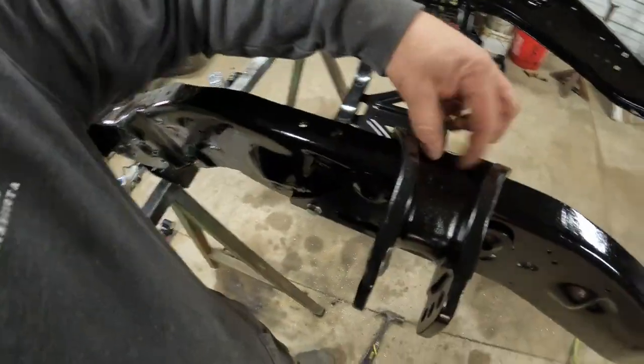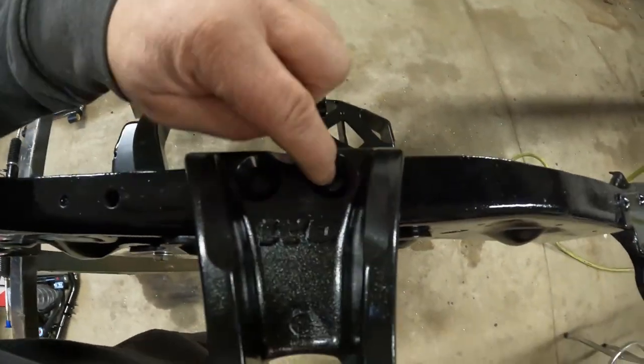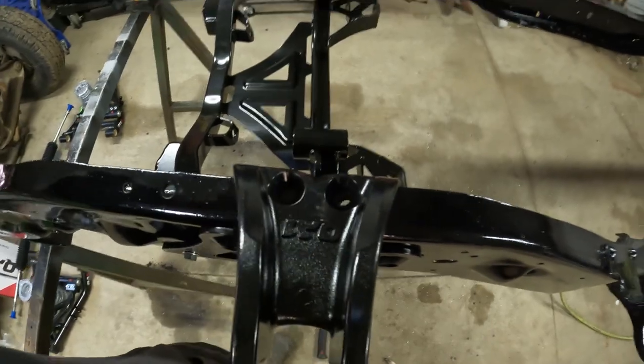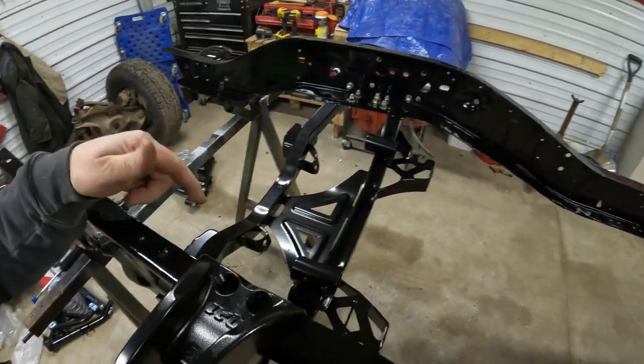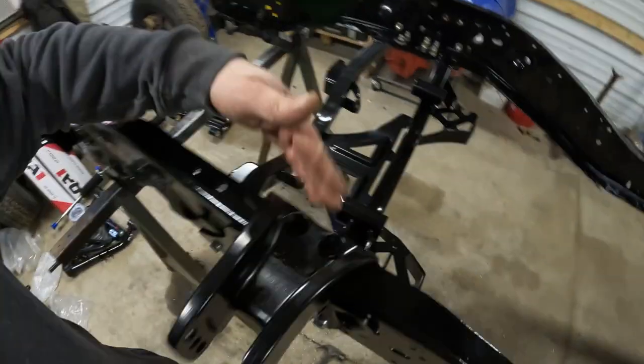I got my bottom four holes drilled and the shock mount up here with just some regular nuts on for now, so I'm going to snug them up and then use that to drill my top one — I was worried about it moving on me. This one is almost going to drill kind of funny being it's going through a half a hole there, so I'll probably just use this as a guide for the bit to keep her from getting out of track. Then I'll do the other one on the other side, pull it off, clean it up. There is an inside bracket here that uses the same bolts, and an inner frame bracket that's going to tie this shock mount back to the crossmember.